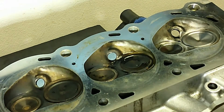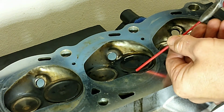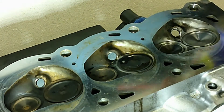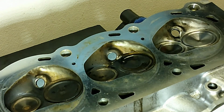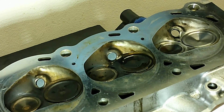Now we've moved on to cylinder number two. The one on the right was the first one we dealt with — that was the cylinder that had the best compression, I think it was 75, and we still had pretty significant leakage there. So cylinder number two, we're expecting it to be much, much worse. And when I put the WD-40 in around the intake valve, it didn't even puddle — it immediately started to soak through the valve seats.